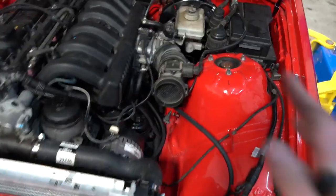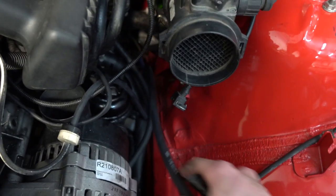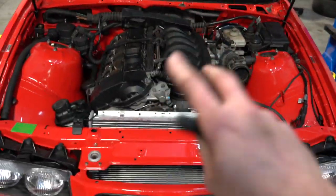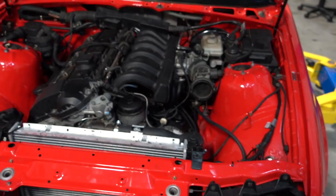I've done a lot of research. Some of it's available online, some of it's not. And then there is this piece that I'm missing that comes from a little blue fuel air hose in the back. I'm missing a piece that goes here that is the purge valve. So I just went ahead and put a hose on it. It goes from the blue hose up into the intake manifold. So we had 2 really big size holes underneath the intake manifold that were open. So hopefully that kind of allows more vacuum how it needs to be.